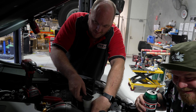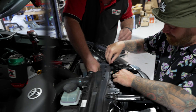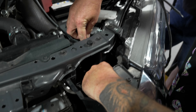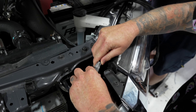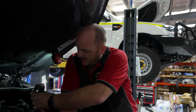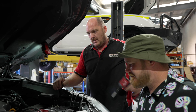There's a Deutsch connector here from the light bar as well. You can see the gap between the washer bottle — just feed it through there, grab the two connectors, and plug them in. We'll come back and tidy this up later. Just nip up the relay bolt, adjust where the relay sits, and done — that is magic.